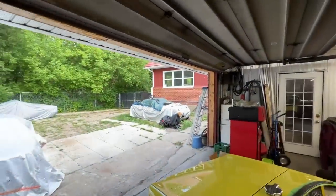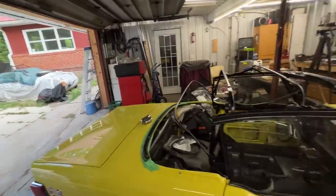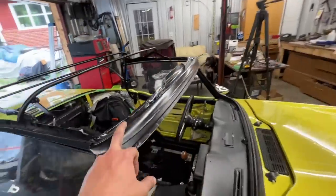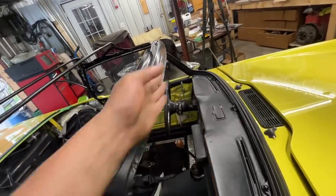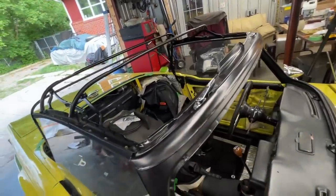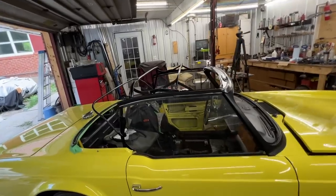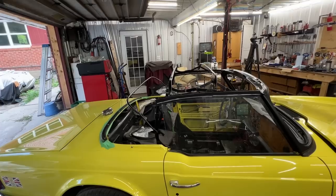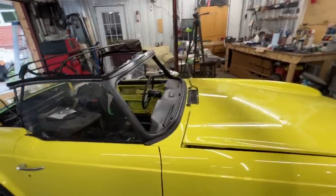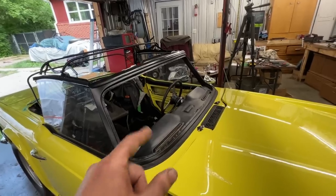The two straps are painted but I still don't have confirmation from the owner that it's okay to reuse them, so I'm not going to proceed with those yet. I also can't install the front seal because the actual top needs to go around the lip and tuck underneath before the rails are installed over it - so that front seal goes last. Unfortunately I'm going to have to wait for the owner to respond. In the meantime though, I'm not stopping completely - I'm going to start a new video in which we install the windshield. So the next time you see me, the windshield will probably be on the car.